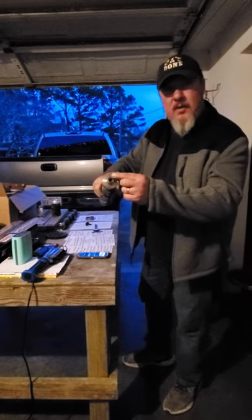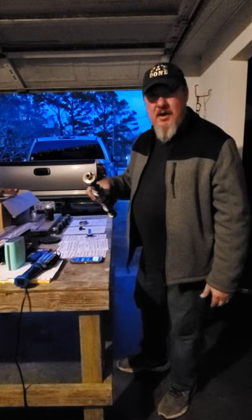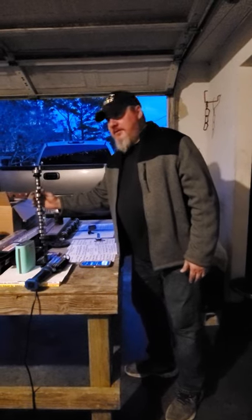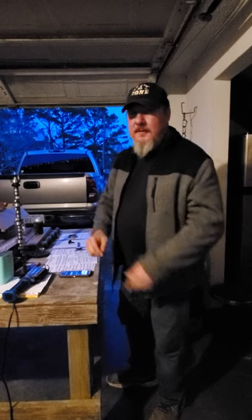I put the long dowel in, and guess what? I don't use the long dowel. I use a two-piece fuel pump eccentric. So, that video is totally incorrect. If you're a Ford guy, 289, 302, 351 Windsor, do not watch that video.